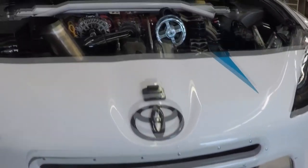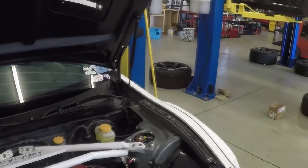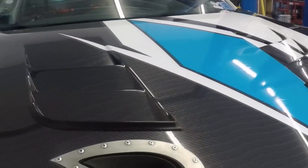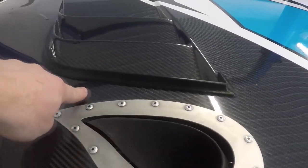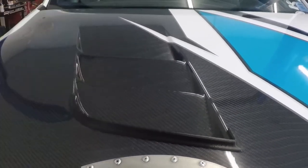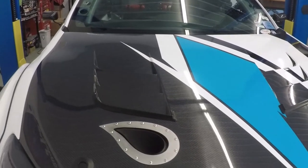There's a small slit up here which only goes through part of the oil cooler and part of the radiator. To finish off the cooling, we 3D-printed some wickers — you can see them right here — which should aid in hood evacuation. We don't know yet if that's enough, but we'll find out.